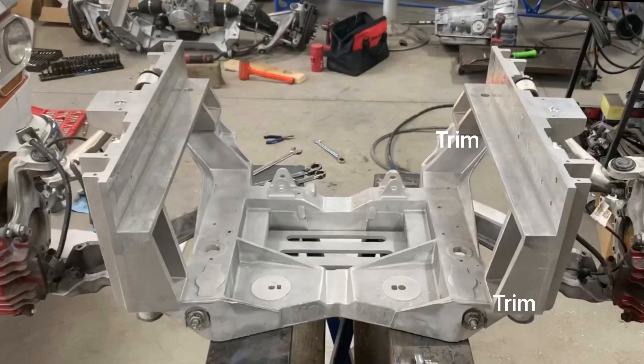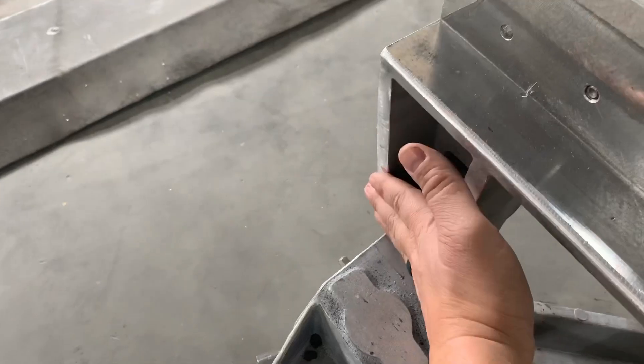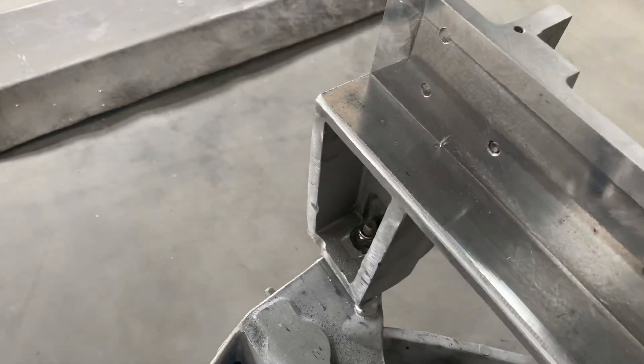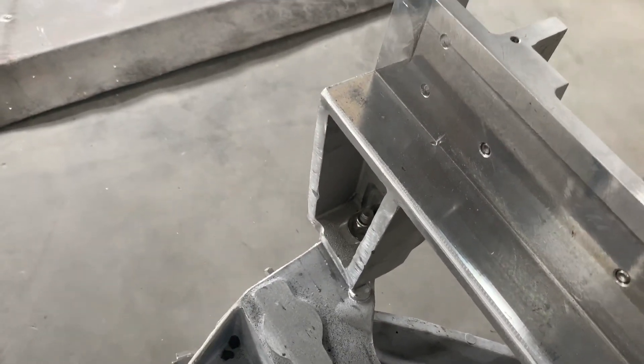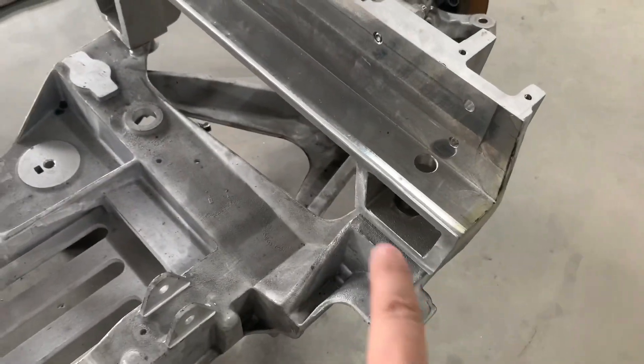This is the original assembly of the front cradle using the Dauberton brackets. We've had to trim a little bit of the excess meat on the front and the back of both sides. If you look here at the back, the reason we did that is so we didn't have to take away too much of the original frame structure of the Corvair, so this will fit up inside. We also trimmed this little section at the front.